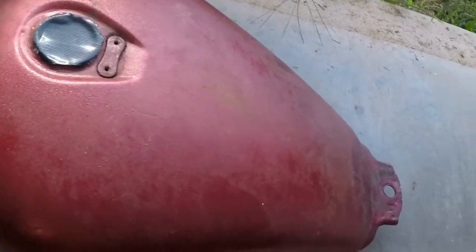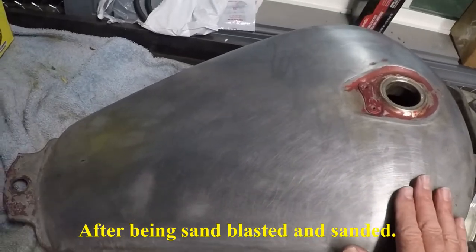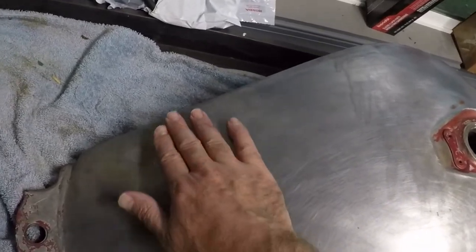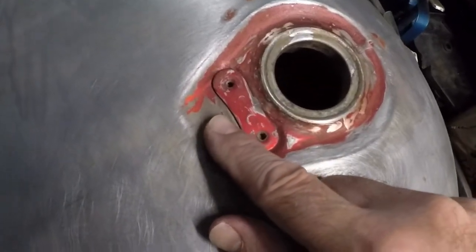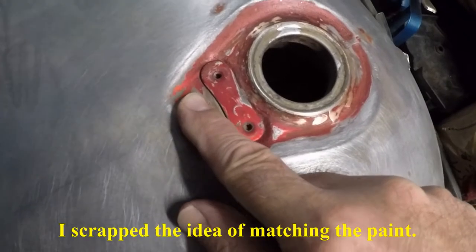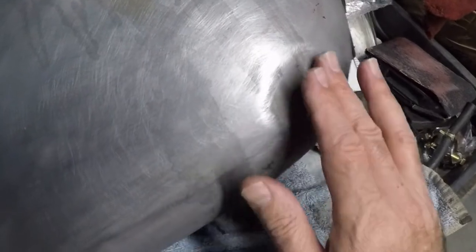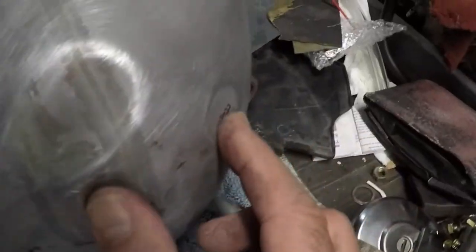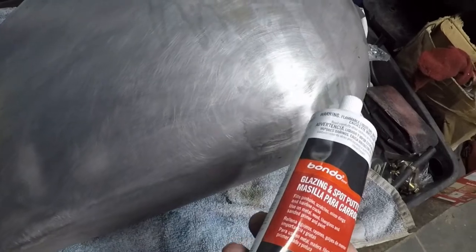This is what it looks like before being stripped. This is how the tank came out after I sandblasted it. I've sanded it down with some pretty coarse sandpaper and gone over it with acetone, and I'm going to go over it again since I've been touching it. I think that there is the original color — I'm going to try to match that. There's a couple dents I want to fill in: here's one, there's one right here, and there's a little one right here. I think that's about it.